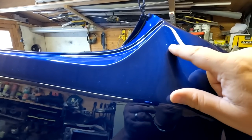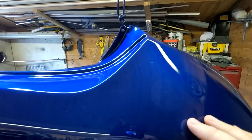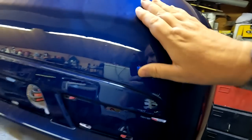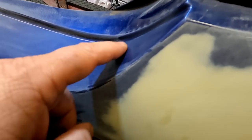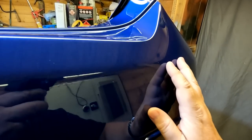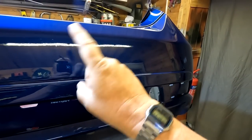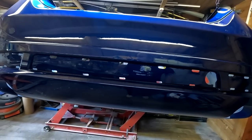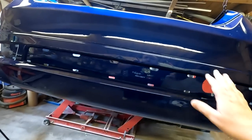All you've got to do when we put this back on the car is, anywhere where there's a little nib of dust — you just give that a sand with some 1500 paper and then buff it with some G3 compound on a buffing wheel, and that takes all that out. Can you remember how I scratched up all this lacquer when I was sanding it earlier in the video, thinking oh my god? That's putting the lacquer directly on top, and can you see the shine you've got there — fantastic. We normally could have done a spot repair blending the lacquer in with a lacquer thinner, but rather than do that, Jimmy just lacquered the whole bumper to give it that new fresh look again.